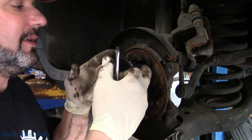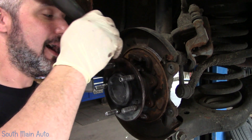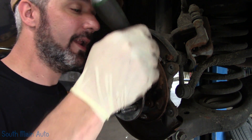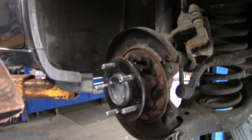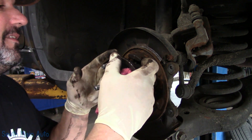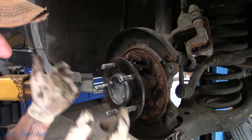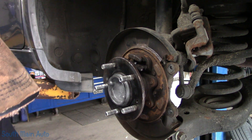Now the actuator assembly up here on this one is heavily lubed. I'm not going to spray it off with brake clean — yes, you heard that correctly. I'm just going to knock a few little chunks of rust off it. It is in good shape. The vehicle is a stick shift so he does use this parking brake quite often. If yours is all seized up you'd have to pull the whole mechanism out — not sure if you could just unhook the cable or if you'd actually have to take the wheel bearing off. We're very fortunate because this one is all loosey-goosey.